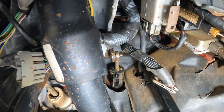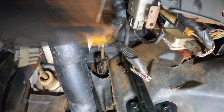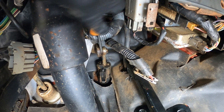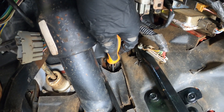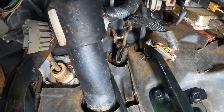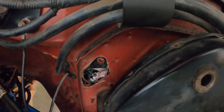What I did is I got me a flathead screwdriver to kind of help me ease the connector out and then slide it out. There we go. So now I got a bolt there and then a bolt here, and be able to slide right out. It comes out through the outside here.